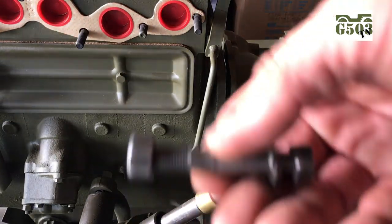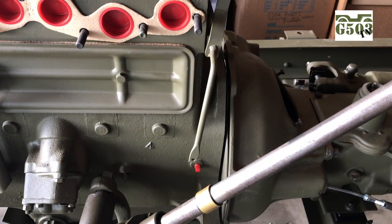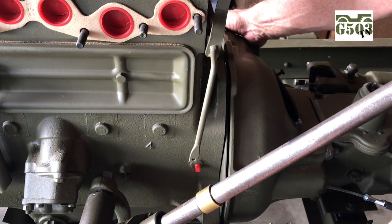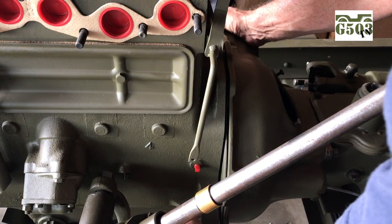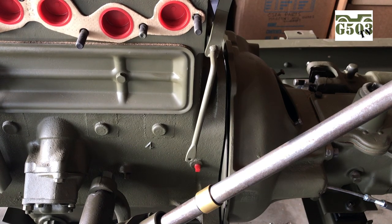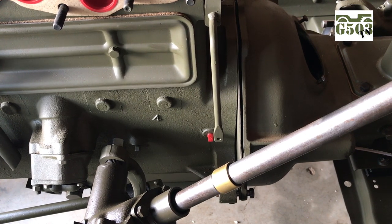I'm going to show you the dowel bolts — they're part number 630101 — and they're extremely important in lining up the bell housing to the actual back side of the engine. You'll install the dowel pins on the ears on the engine on each side of the motor going back into the bell housing. Make sure that your backer plate is correctly aligned and the hole for the starter is in the correct spot, and these bolts will go in really easily. This is going to make sure that your bell housing is correctly lined up with your engine. If you don't use the dowel pin bolts and choose to use modern bolts, you run the risk of being as little as a sixteenth of an inch off alignment, giving your throw-out bearing a very tough and short life.